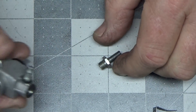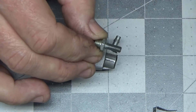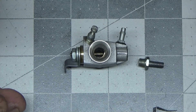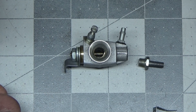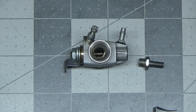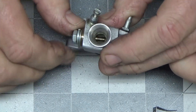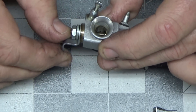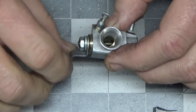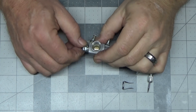I don't see any other options. I don't want to put a different carb on here even if I had one that fit. So that's left me with modifying this — I don't really see that I have much choice or have anything to lose, because as it is this engine can't run. I did have a Testors engine and a McCoy's engine like this a few months ago with the same problem — you could never close off the flow of fuel completely and the engine would never lean out. One of my viewers told me this was a Russian-marketed engine, which is why it has Russian text on it rather than saying MDS, which would have been marketed for the rest of the world. I still don't know a timeline for this.